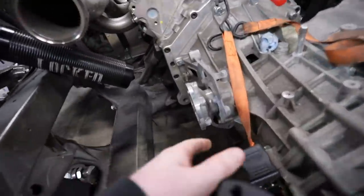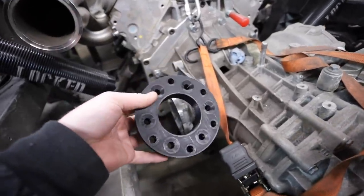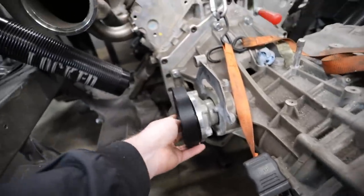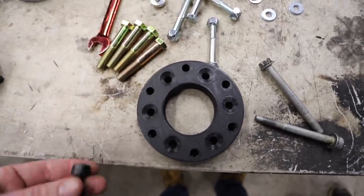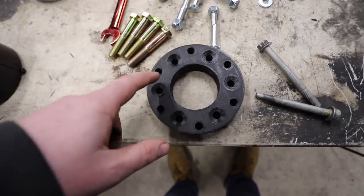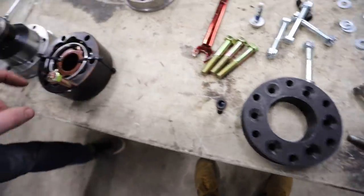On the other end, on the opposite end, we have the Lamborghini Gallardo style axle connection into this. We need to go from that into another CV so we can have angle there. That is what this piece is right here — I 3D modeled this and 3D printed it last night. This bolts on right here with some flat head bolts and then has threads for the CV to bolt onto, and then we just have an axle shaft. But what we found out is this needs some modification. The flat head style bolts that I wanted to use for this don't really exist, so we're switching over to a cap style end. We're going to go ahead and machine this out to accept the cap style end, and widen these holes out to match the thread pitch that goes through our CV.